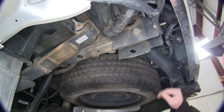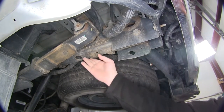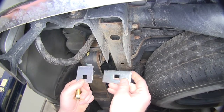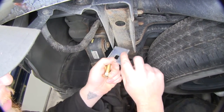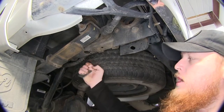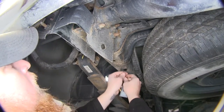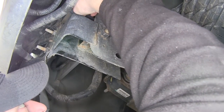First, we're going to get underneath the back of our vehicle. You can see that we do have the factory hitch here — it's going to be welded, and the new hitch is going to come underneath it. Locate the mounting points for our new receiver hitch, which are the big holes located here and here. You're going to have two different types of blocks: the skinny one goes towards the front, and the larger one goes at the rear, on the other side of the frame rail. For this front mounting location, we need to get the skinny block into position over the hole.